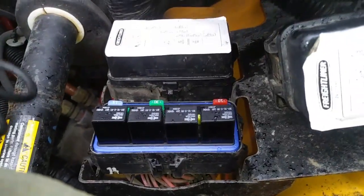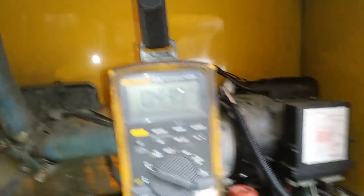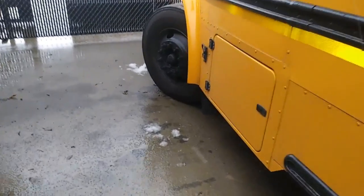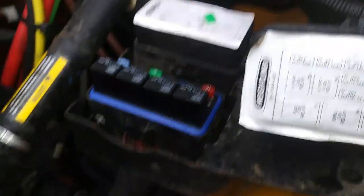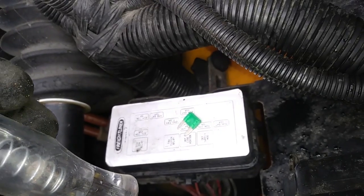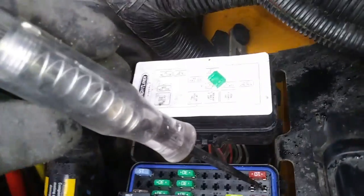How do I know that this is the fuse that WB-STO could stand for? Well, you can remove the fuse and see if our voltage drops to zero — so that's what we're going to do. You can see the connectors look clean there. If it drops from eight volts, you basically know that fuse is the supply for this. We're at 0.4 volts, so basically that fuse is the supply. Now we've got to figure out why it's dropping all its voltage between the fuse and back there on the bus. Since we have the fuse removed, you're going to have voltage on your input side at all times — or you should. So your input side's okay, meaning the outermost wire is going to be your output side.